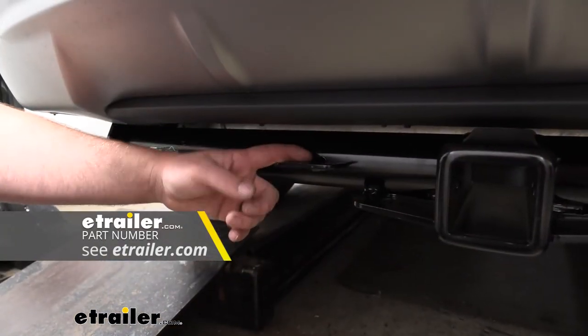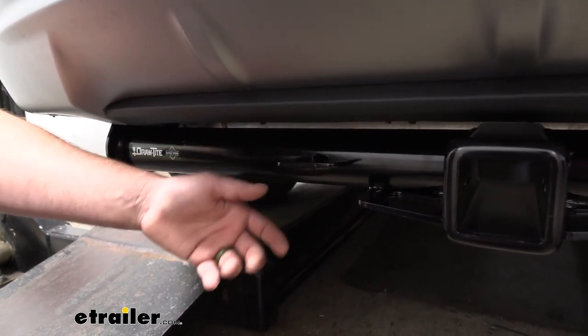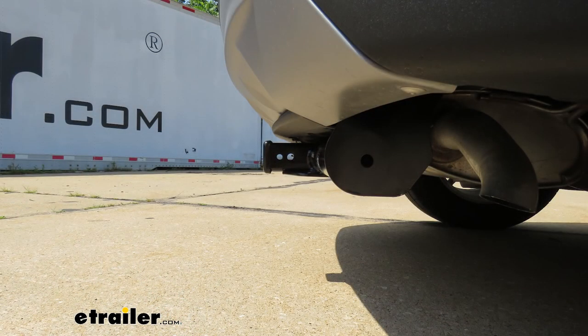If you do end up picking up trailer wiring, the hitch already has a pre-attached bracket on it so you can mount your wiring up and not have to worry too much about it. I'm going to give you a couple of measurements to help figure out which hitch-mounted accessories to get. From the ground to the top inside edge of the receiver tube opening, that's going to be about 12 and a half inches. From the center of the hitch pin hole to the edge of the rear bumper, that's going to be about 6 inches — you can use that to figure out if folding accessories can be stored upright without contacting the bumper.